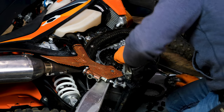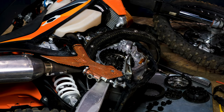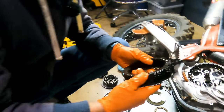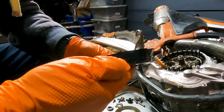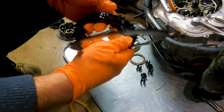I should have been doing this whole time is soaking the new clutch plates. While I install the basket and everything, I'm going to get the new clutch plates soaking in oil. Let's take a look at the friction plates from the original OEM stack. It's a hundred hours of relatively hard riding on this stack. I don't see any bluing from overheating, which is cool.